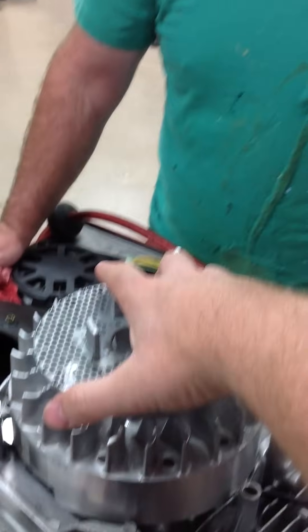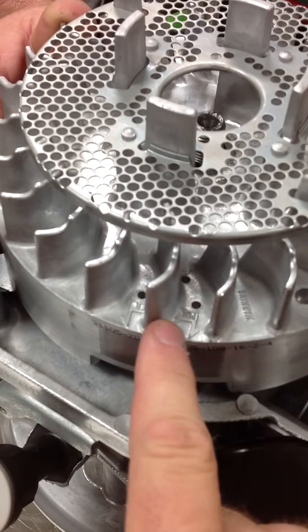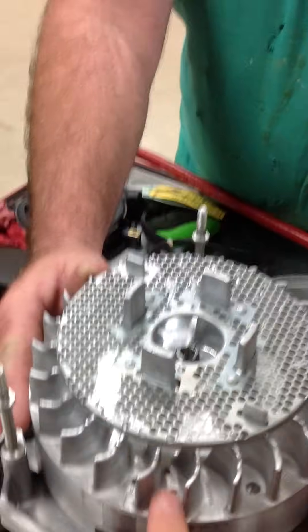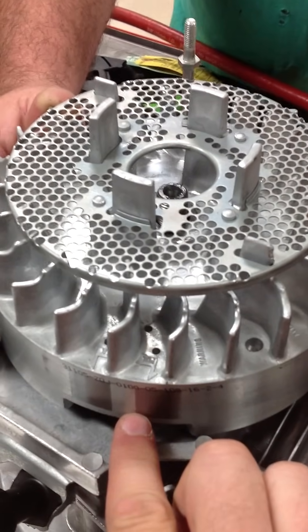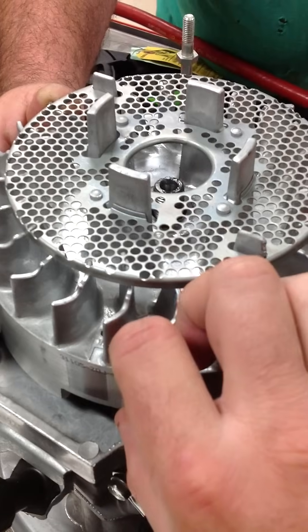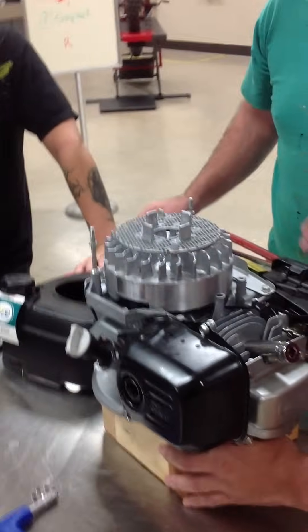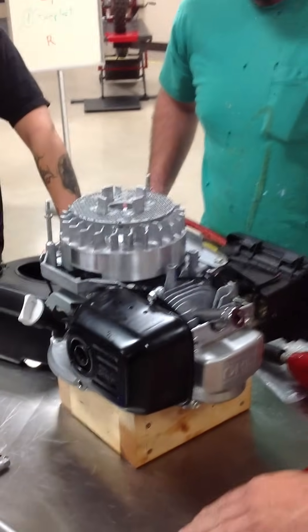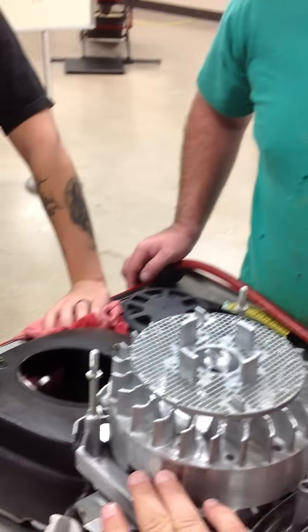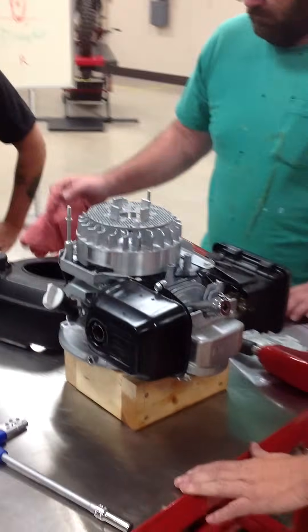One thing about the Honda engine here — you can actually see how Honda has located two places on either side of the flywheel to install the puller. One thing that's kind of surprising to us is it is right by the magnets. So knowing that the puller is going to be in close proximity to these magnets, we want to use some real caution. In one of the other training modules from Honda, they had a warning to never install a puller anywhere by the magnet — kind of interesting comparing one engine to another.